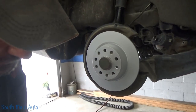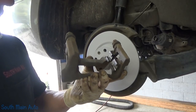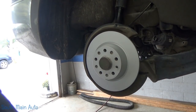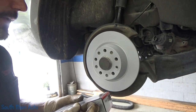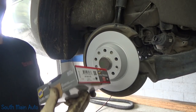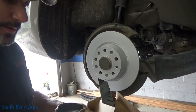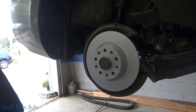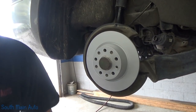So I'll get that on. I've taken our caliper bracket and already cleaned it up — these were quite clean; I just had to barely touch them with a flat file or a little square file and a wire brush, and they're good to go. So I'll get a little lube on them. Got some NAPA Ultra Premium. Are these right? Got hardware — they look great. We're in good shape for the shape we're in.